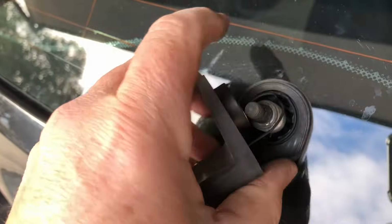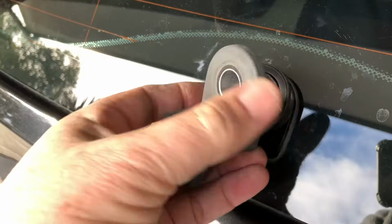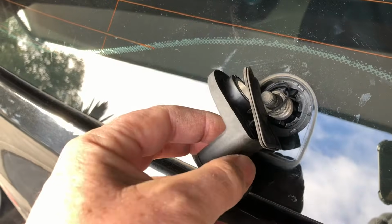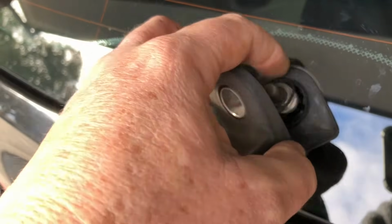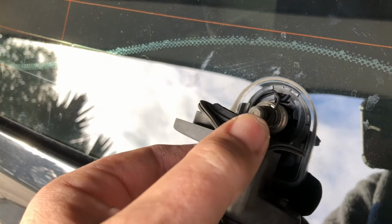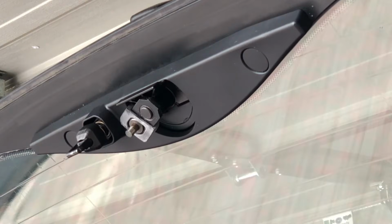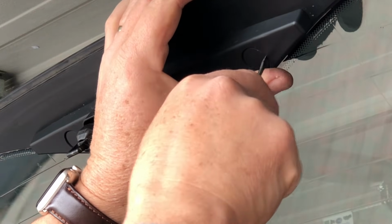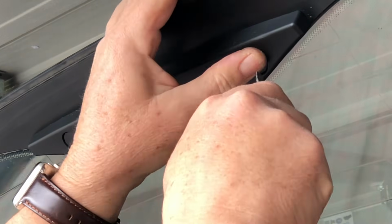There's a rubber seal there on the glass. So I'll check and clean all of that as well. And obviously that would come out if we went to that switch on the other side. And we'll probably do that as we try to clean the whole assembly. But we're still connected, so we can't get him off to have a really good look until we go to the other side and disconnect those 2 wires. Okay, so we're going to keep on digging and come in underneath, and again, very careful with the screwdriver. I don't want to end up with all of these damaged.